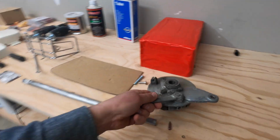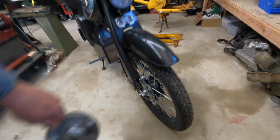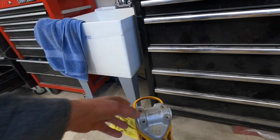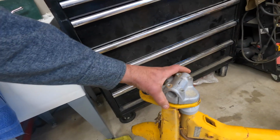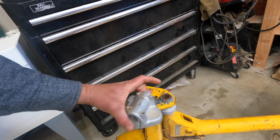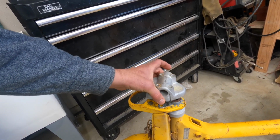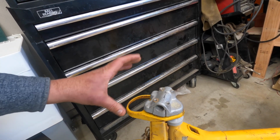You'll have to clean up some parts, as I mentioned. So you'll have to clean up this brake cover part. This is the mount for the handlebars. Not only do I clean this up, I make a small modification to it. There's a rubber bushing that goes in here, and that rubber bushing can get really wiggly over time. So I modify that so the bike has a more rigid and strong feel.